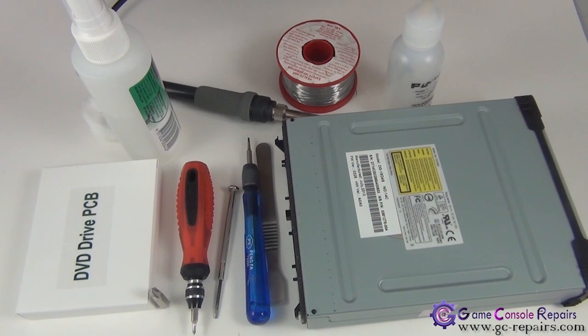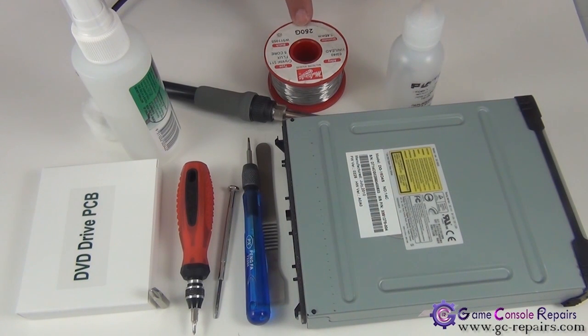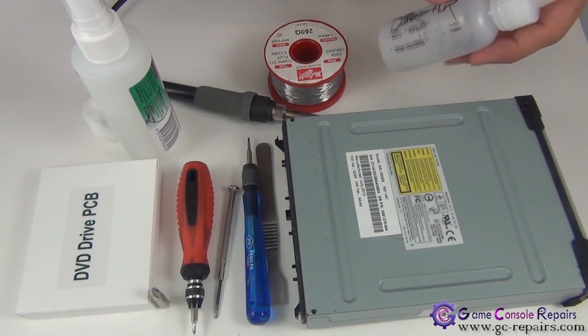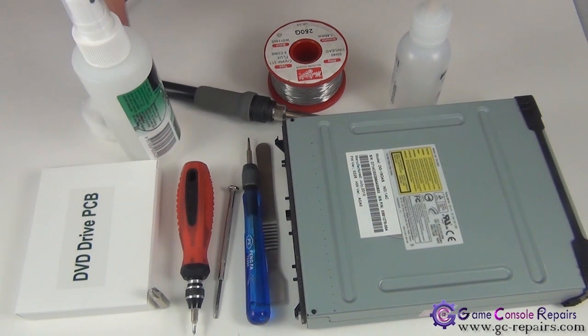You'll also be needing a bit of soldering stuff, so a soldering iron, 30 to 40 watt, preferably a reasonable soldering station is always handy. Solder, the ratio we have here is 60/40, and the diameter we use is 0.46 millimeter. Very important, flux. Flux aids in the soldering process, so a bit of flux is also needed. In order to clean up the flux, you need a bit of cleaning stuff as well, so you need isopropyl alcohol and some cotton balls. Alright, let's get going.